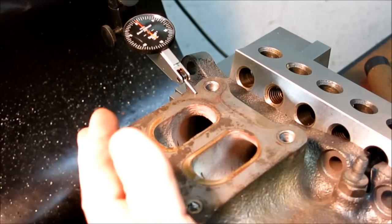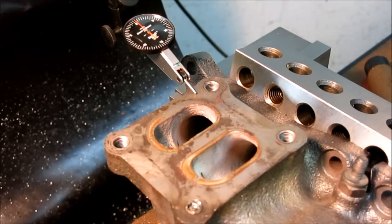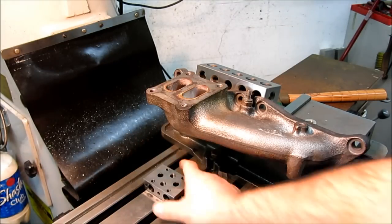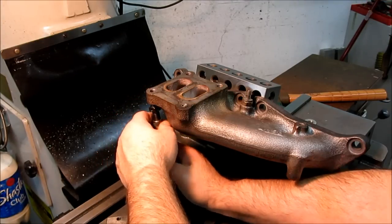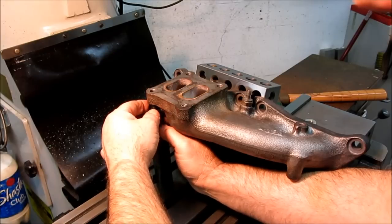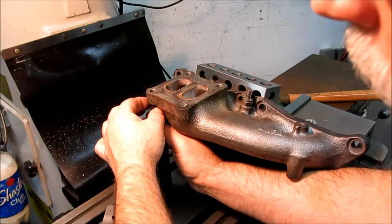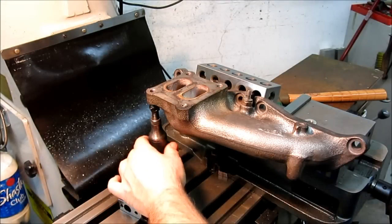The other thing I'll do is put a jack underneath this, because I'll be pushing well off of the pivot point here. Just to support it under here is a good idea. Let me get a jack and put it under there. I'm going to go right up into that bolt hole there. I've got the pointed screw so it's going to kind of self-center in that — hopefully be happy in there. I don't want to put much pressure on it; I don't want to push it out. All this is, is really just support for when I push down here. Feels pretty good. I think I'm going to put a clamp on that.